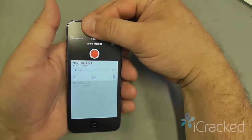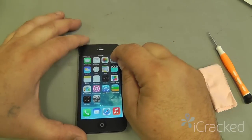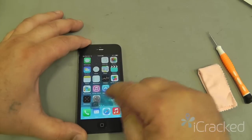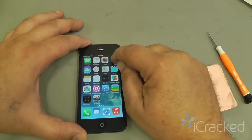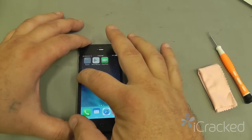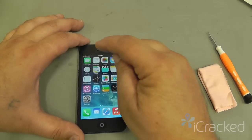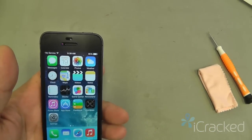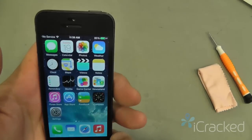Listen to it to test your ear speaker, and when you put the phone up to your face, the screen should dim. And again, we're going to test the touch screen one last time by grabbing the icon and moving it around. If the icon drops, that can indicate a problem. So this one was satisfactory. I want to make sure that it picked up Wi-Fi signal. My battery is now at 85%. I want to make sure that I didn't damage the charge port while doing this.